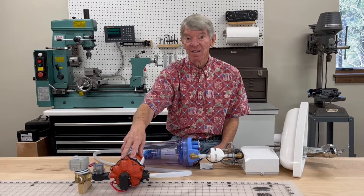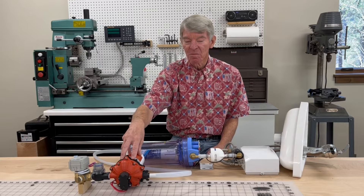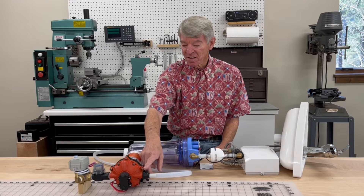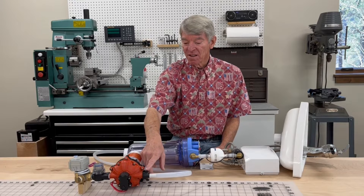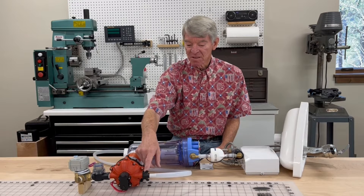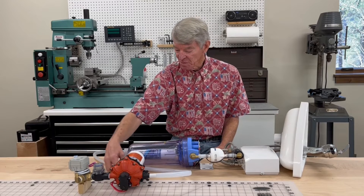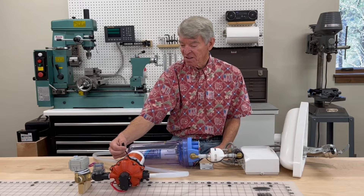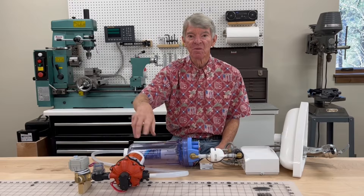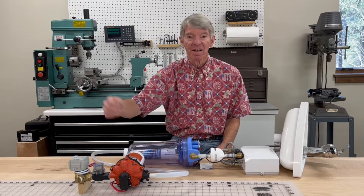A five-gallon-per-minute pump was used instead of a three-gallon-per-minute pump, generating a lot better water pressure for the shower. There's a fitting that comes with the pump that leaks, but that problem was alleviated by adding an O-ring, making it a nice quick disconnect for the pump. The pump actually comes with a plug, so if you ever have to replace it, it's just an easy matter of disconnecting a few fittings and swapping out the pump.